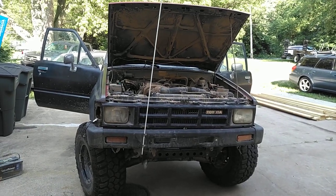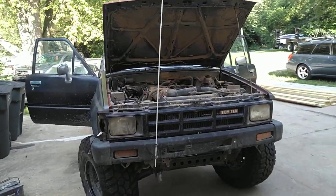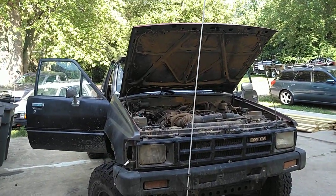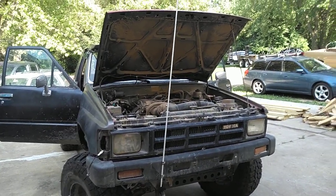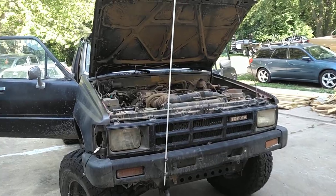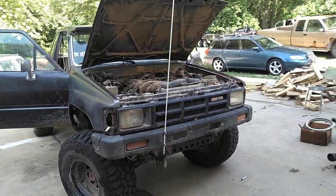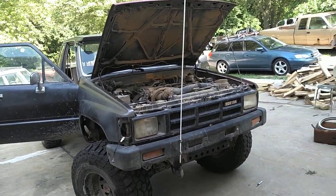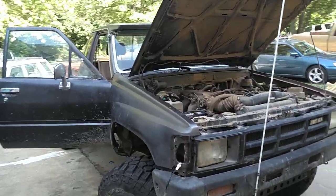Hello YouTube. So I had quite a few people express interest in how I did the air conditioning in my 86 Toyota pickup here, because the system that I have in here and the way it's set up, on an 88 degree day with 70% humidity, was producing 36 degree air at the vents just sitting idling in my driveway right here. And the factory Toyota system running R134A, you'll get like 60 degree air at best under the same circumstances. So here's what I did.